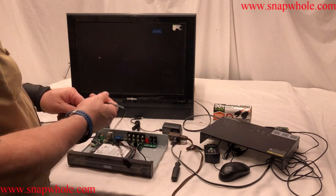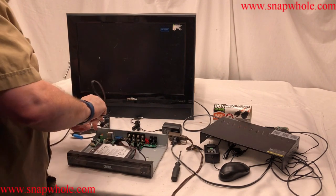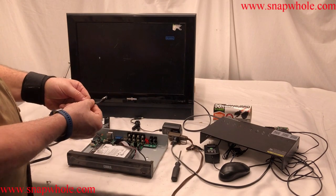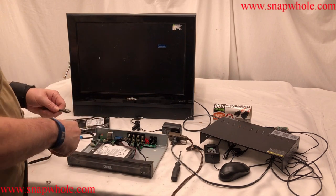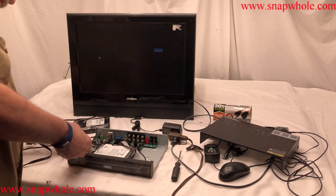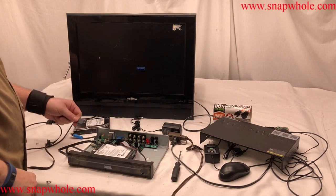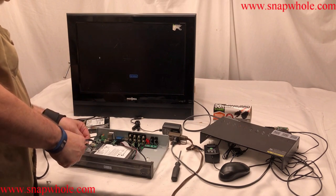I'm going to put the SATA cable back in. This is the same thing your computer most likely uses. The continuous cable, without the 90-degree turn, goes into the drive, and it's keyed so it only fits one way. Silver tab up is the right way, by the way. And I want to use my known good power supply to figure out what's wrong with that other wall wart.